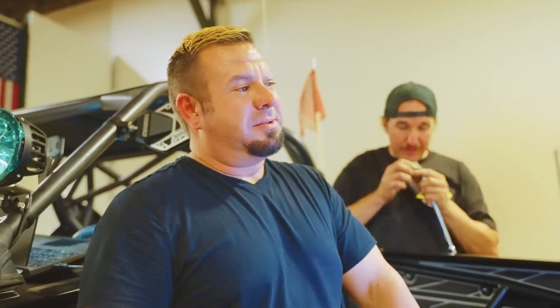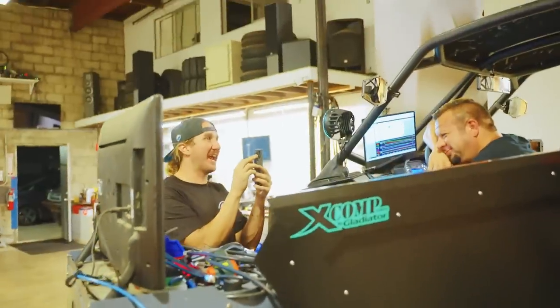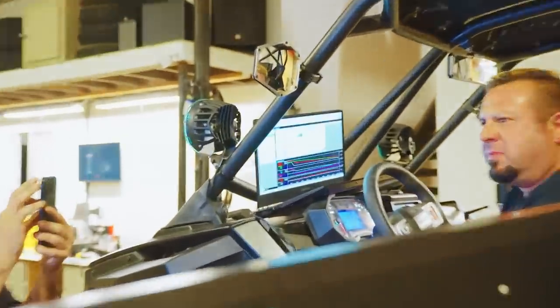We're checking timing right now. That's what we're doing. We're looking at the strap on the plug to see where the timing mark is. Do you like it? I think we'll go a little bit more. More? A little bit. Yeah. Dang. Another 2? Another 2, dog. You happy?